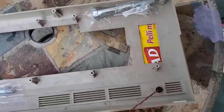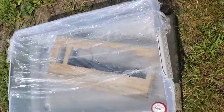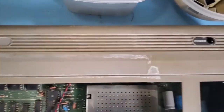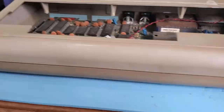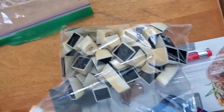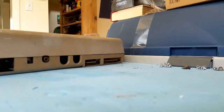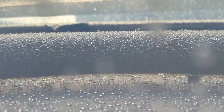Let's add some bolts for some weight because the cover was floating and exposed. Back in the bath. Just let it soak up some more sun rays — we're at plus 45 degrees Celsius. It's looking a lot better, but might have to do something else. Another couple of hours again. I put the keycaps in a bag with hydrogen peroxide. Out of the bath — it's still not the greatest. Back in the bath; let the bubbles do all the work.